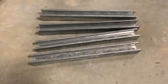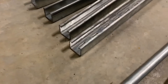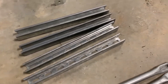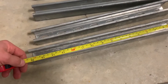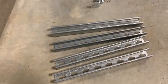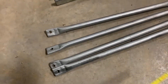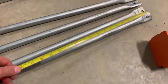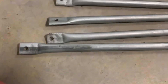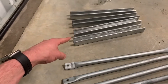First thing: cut the universal channel into 16-inch pieces — 16 inches long, about 16 inches per jack. And the three-quarter inch tubular conduit pieces are 24 inches. So you'll cut these into 24-inch pieces and those into 16-inch pieces.